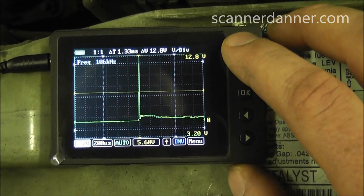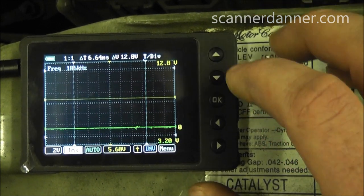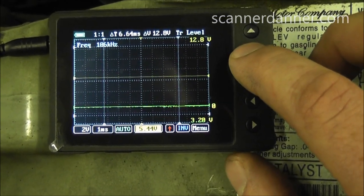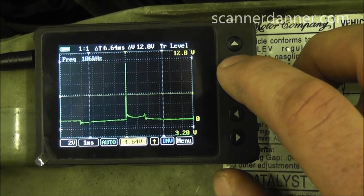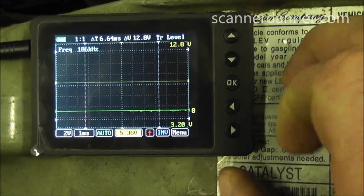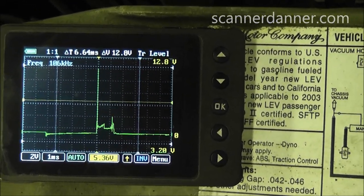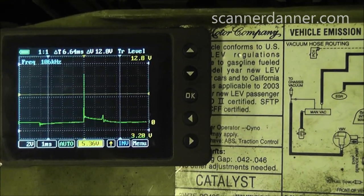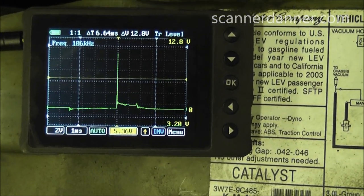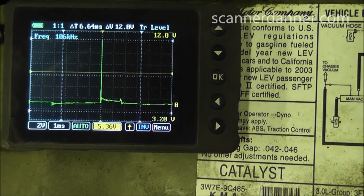This is the initial view. I'm going to change my time base and scales a little bit. There's your ignition firing event on that cylinder. This yellow line on the screen is our trigger level, and that's going to help stabilize the picture depending on the level you pick. I'm going to do some snap throttle tests — I'll raise my trigger a little bit. Watch this while I'm snapping the throttle. This will be a known good cylinder — that looks pretty good. Going to another one, just going to the back three here. Pay attention to our spark line and firing lines — that looks pretty good.